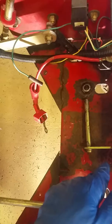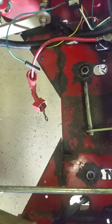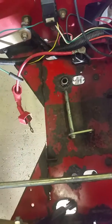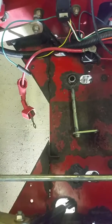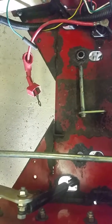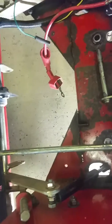Eventually I banged it through and it came out. Just know that you can do it — I almost gave up working on all four wheels instead of flipping it on the side. If you flip the mower on its side, drain the gas first, you'll have a better vantage point. Otherwise you're working from the top and bottom on jack stands — you're at a disadvantage. Flipping it on the side will help a whole lot. I'll try to make a follow-up video on how it actually operates in depth. Like, comment, subscribe, and share.